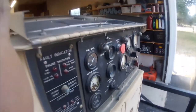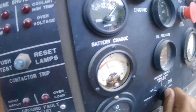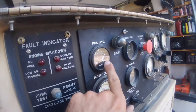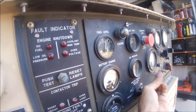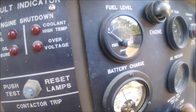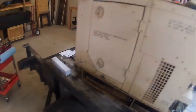I shoved the emergency stop in so the generator won't start. The gauge changed when I connected it - it's working. Flipping it halfway to simulate a half-tank level: it shows three-quarters, which makes sense if it's one inch off the bottom in that position. Pointing it all the way down to simulate empty, it shows around E. It's not quite on E but that's good enough - at E you'd still have about an inch of fuel from the bottom.